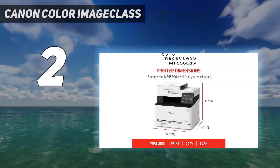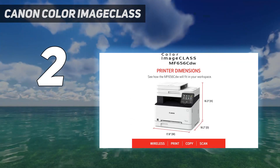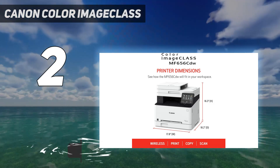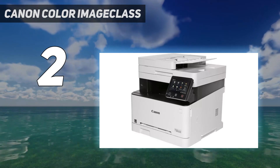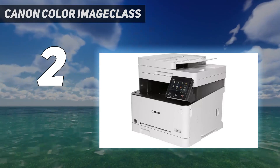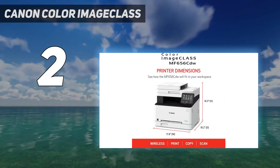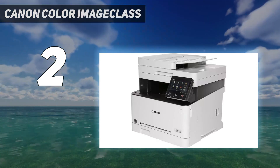Number 2 on my list: the Canon Color Image Class MF656CDW. Our best upper mid-range pick is a color laser all-in-one. It has the same features as the Brother above and produces documents that look just as good. It yields significantly more color prints and is easier to maintain because its toner cartridges contain the drum, so you don't have to replace it separately. The trade-off is that it prints slower at 22 pages per minute, and that speed is only achievable via a wired USB or Ethernet connection. Scan speed is also slower but pretty respectable at 14 pages per minute. Cheaper variants are available, like the Canon Color Image Class MF654CDW, which lacks duplex scanning and fax functionality.